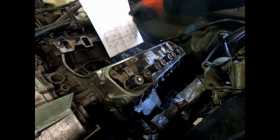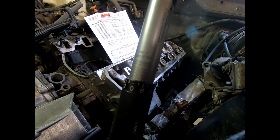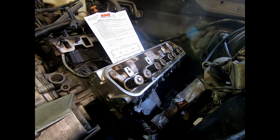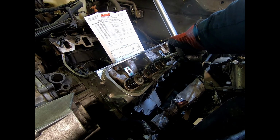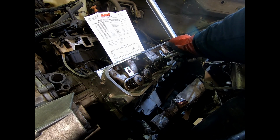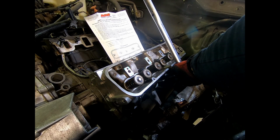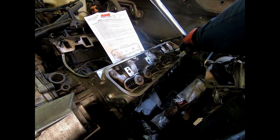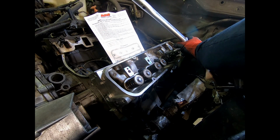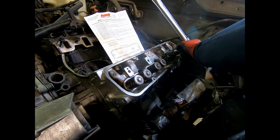And we can confirm here, 70 foot-pounds, round 3, driver's side, starting at number 1. We have the 1/2 inch drive, 70 foot-pounds. Come over to the spot that we just found, works way better. There we go. You want to do one solid motion as often as possible. That's it. Stopped. Number 1, complete. 2. Number 2, complete. Number 3. Good throw. Number 3, complete.